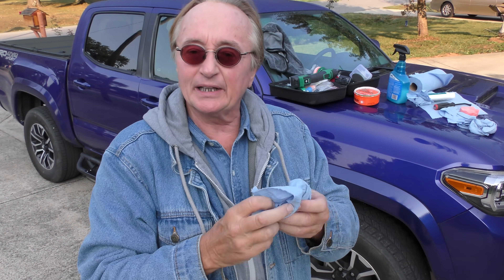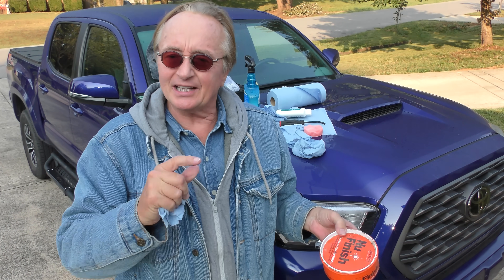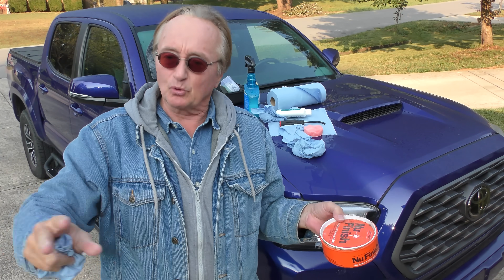They're an uneven surface next to an even surface. The even surface is going to have one reflection, but when you get to the uneven surface — especially in the sun — you're going to see every single dent that tree branch put in. So if you expect perfection on a dented vehicle by polishing it, you're not going to be happy. If you just want to polish non-dented areas, they're going to look beautiful with the random orbital action. And by the way, when I spun it near the camera, it got my camera all covered and polished — I buffed it off and it looks a lot nicer. The only thing I really clean is the lens, and it works really well on plastic, just use fine stuff only — don't use coarse stuff on plastic or you'll scratch it.